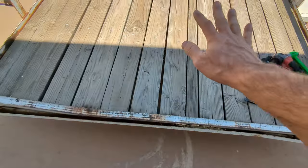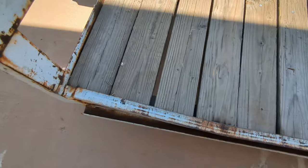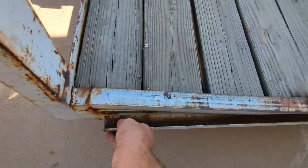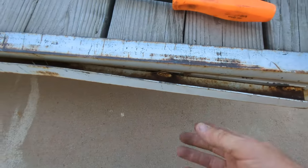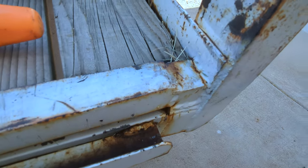What happened here was a forklift loading some stuff for my dad caught and pulled this back. I've already bent it back into place somewhat — it was touching here, you couldn't fit anything between. It broke over here; looks like it's been repaired a time or two, but it broke here and that's not connected anymore, all the way across and down. It also broke the hanger for the ramps — both sides are broken. It doesn't look like the welds broke flush with the beam itself, so I don't think the penetration was very good.